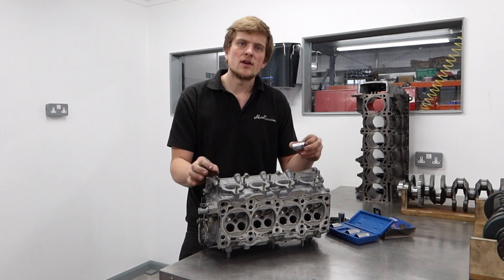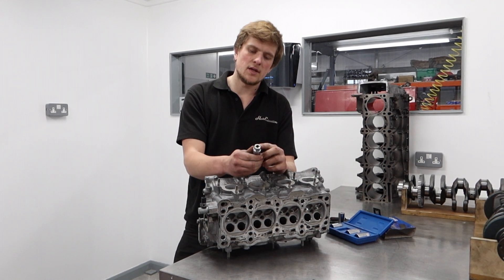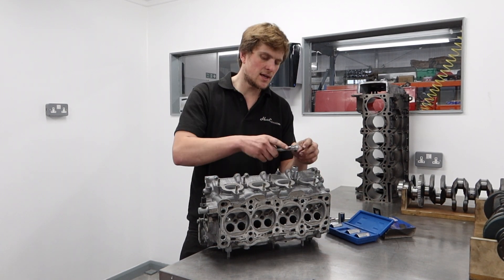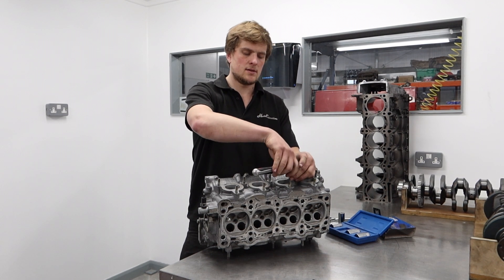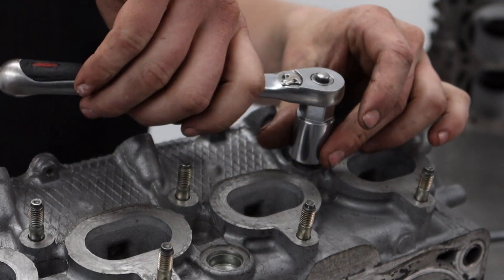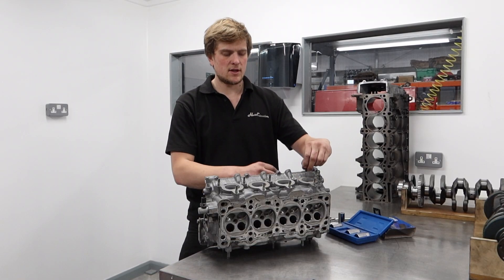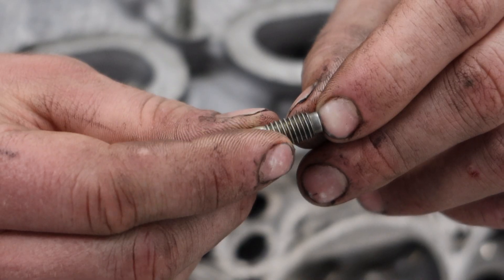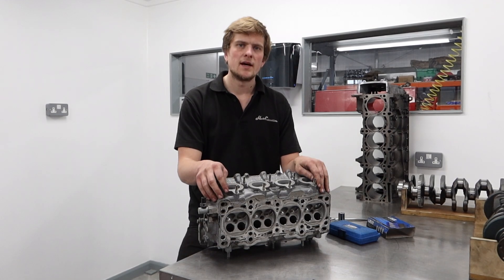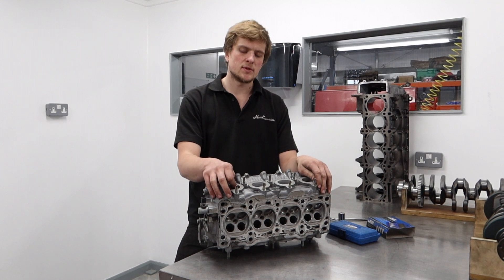So we've got an MX-5 head in front of us — let's have a go at undoing one of these studs on the intake flange. You can either put a 19mm spanner or a 3/8 ratchet on the end; obviously a ratchet is going to be slightly quicker. So we pop it on there. As you can see, the jaws inside the socket grab onto the unthreaded section of the stud. As you can see, they're far better than the double-nut technique which we've all used in the past. They won't do stubborn studs, but definitely worth purchasing and well worth keeping in the toolbox.